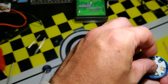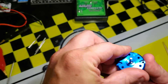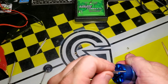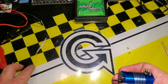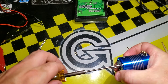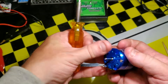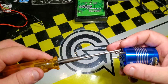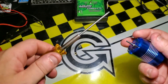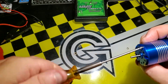It came with this little gasket as well to keep it from shorting out, and the front piece. Now we'll just put the screws through. You can see this motor is quite a challenge to put back together. This motor only has three screws holding it together — nothing in the back, no timing adjustment. As we mentioned before, the timing of this motor was 26-27 degrees, so very mild timing, probably better for a modified setup. A motor like this should have about 45 degrees of timing.